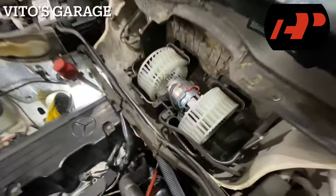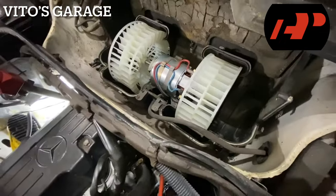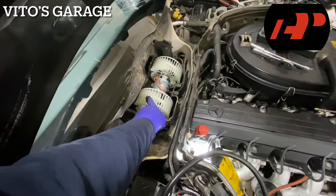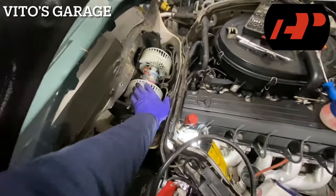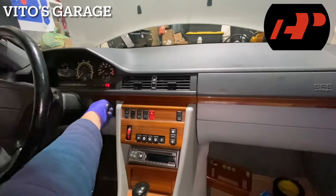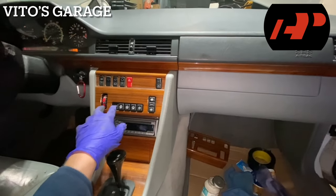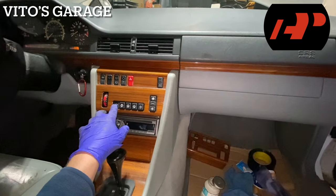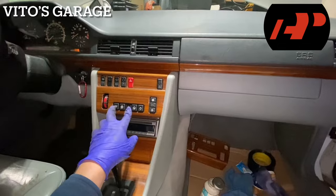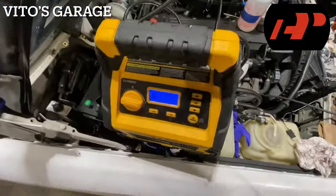This is all installed. I'm about to hook up the jumper to the battery and turn this thing on to see how she does. Before you activate it, make sure you spin it by hand to confirm it's not hitting anything and that it's all secure. There it is — it's working! I think the jumper is dying, it's like nine volts, but it's working and spinning.